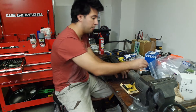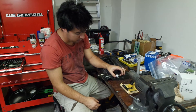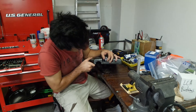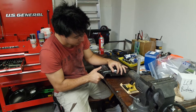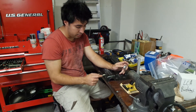So what does that mean? A couple of things. One, we have some 10AN fittings. We're going to essentially do something like that, except not just weld that on. You can see there's a pretty big volume difference in terms of cross-sectional area. So with this one vent we're probably going to get more venting than the two vents combined, because this one is actually extremely restrictive.